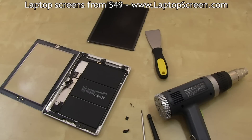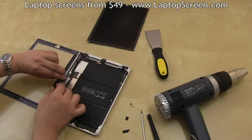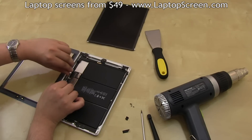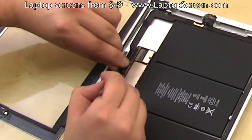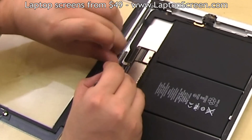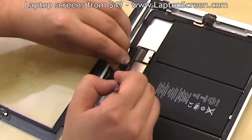At this point, a new or original digitizer can be reconnected. Make sure to remove any protective film from the inside of the digitizer if present. Then slide the cable back into the connector — you may use a flat screwdriver to gently help slide the cable in place. Ensure that both white lines in the cable are hidden by the connector, which will indicate proper positioning.